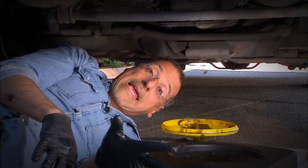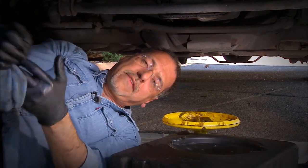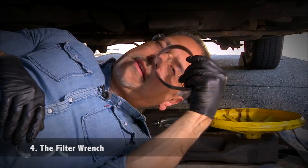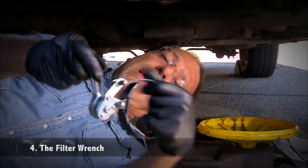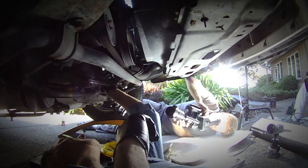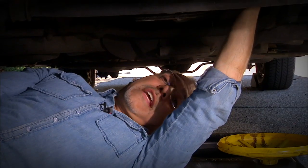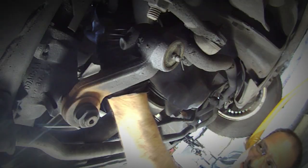We've emptied out our crankcase, put both drain bolts back in, and cleaned up around them so we can spot leaks. But we're not done yet — we've got to pull that filter off, and it's got oil in it as well. We're going to use this filter wrench. It goes around the filter, grabs it, and unscrews it. You've got to get the orientation right. I like the ones where you attach your own ratchet because it's a smaller apparatus to store. Go about a third of the way down the body and turn counterclockwise — like anything else you'd loosen — and it starts to come away from the block. Once you get it loose, pull the tool and you can do the rest by hand.